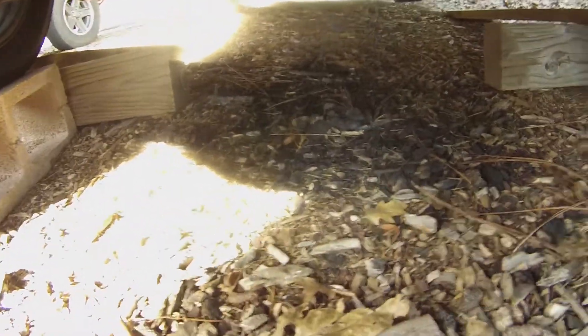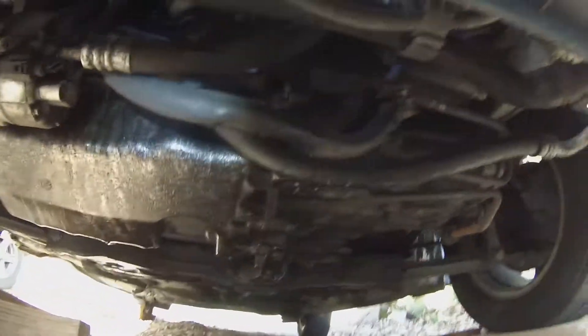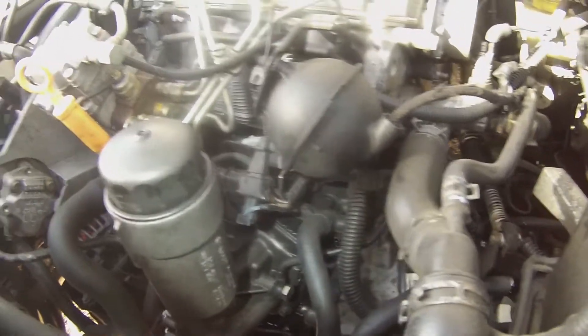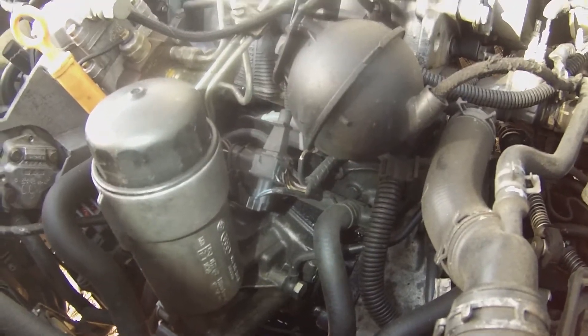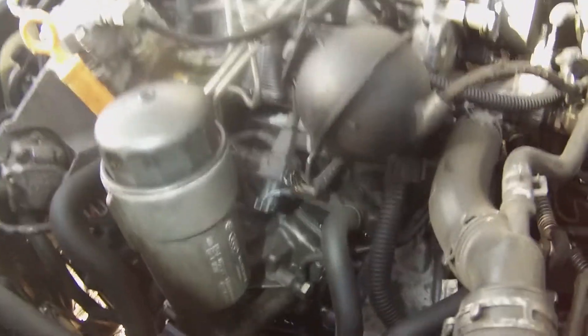You can also see down here where I park, usually all this bark is turned into what looks like charcoal, and the whole bottom side of the car is just completely caked in oil. I suspect the oil is leaking around the bad seal between the oil filter housing and the block, so that's what I'm going to try and fix today.